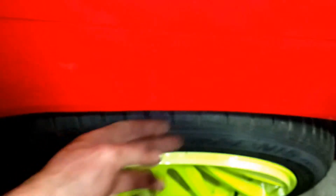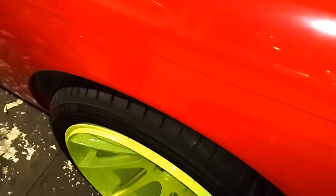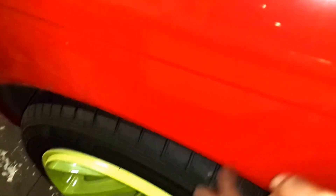I pushed it a little bit further just to see how far the disc can stretch, because this piece of the fender needed to come further out so I can try and cover the wheel a little bit. The idea is flaring it - on this one there's no space, so as soon as this baby squats it's just gonna hit. So the plan is to flare it as much as possible, then make proper fenders that come down a little bit lower. I want to avoid doing any cutting on the body.